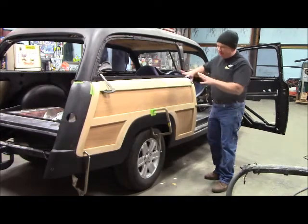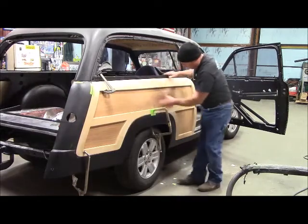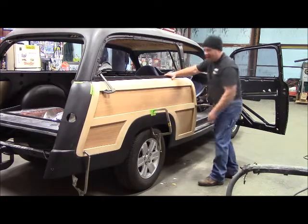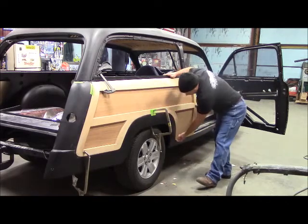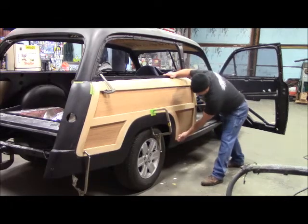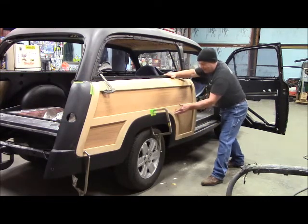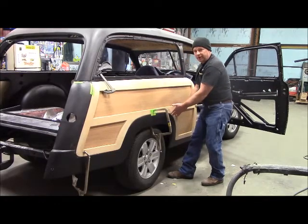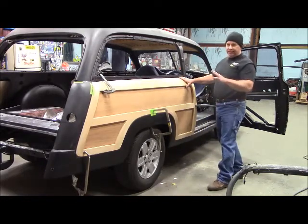After all that metal moving and grinding and work I've done, I've got it laid in there pretty dang nice all the way around. I've still got a little bit right here that I'll have to take out, but it's fitting nice. It's just a lot of off and on, grinding and fitting. Once I get this body line around through here, I'll start setting the depths — where it's out a little bit here, I'll have to make a shim to stop it there and pull it down here. I'm worried about cracking it, so I'm not going to move it too far.